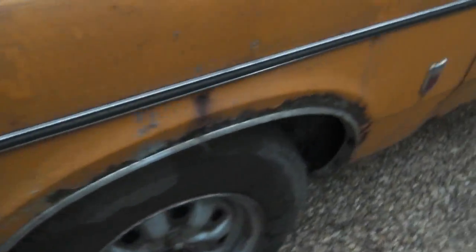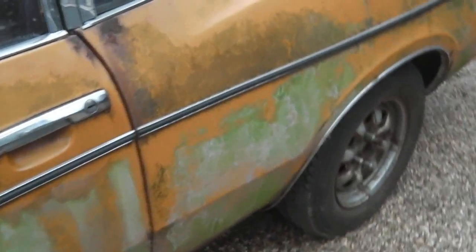Bonnet down. Underneath here we knew those jacking points were still there, but they're crumbly. We've got some holing through, but then it stops on the A panels, and the A panels are good. Now where your feet would normally go, you normally get a big hole there. There isn't one. The front chassis leg's shot there, and that's making the car slightly move on the frame. When I'm braking I can feel the assembly moving, but it doesn't matter for the show, as you can appreciate. It's just to get it in and out of the arena.